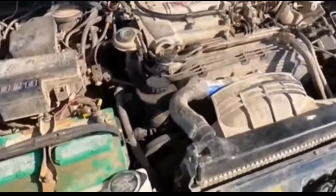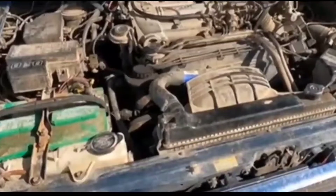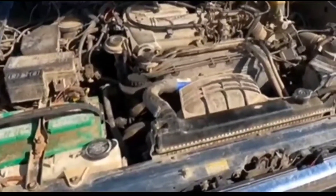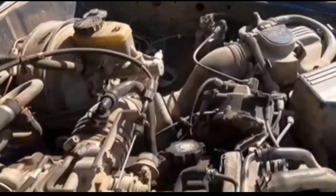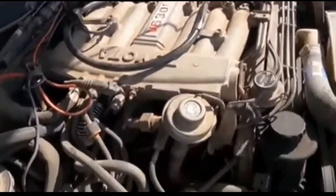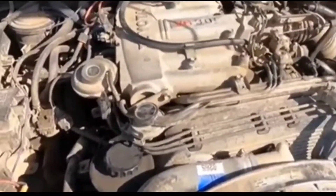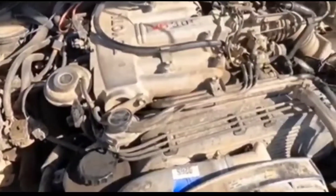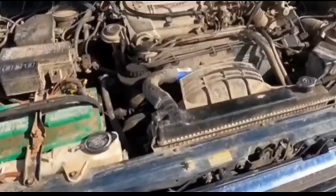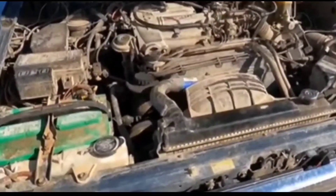I was a little worried. I thought maybe I left the lights on, so I turned my headlights on and went out to check them. If you want to check your battery, just turn on your headlights and look — if they're strong, chances are your battery is good. That's not always the case, but normally even if the battery is a bit weak you should get a slow crank. I wasn't able to get any crank at all.